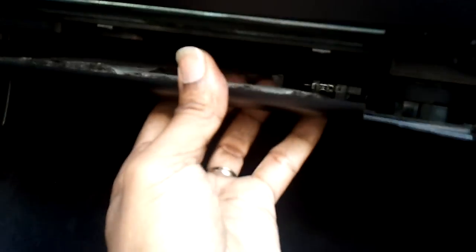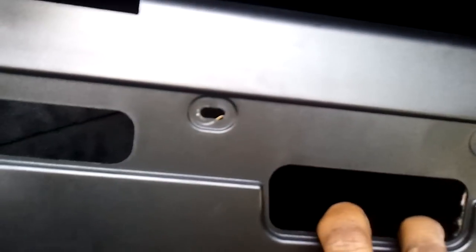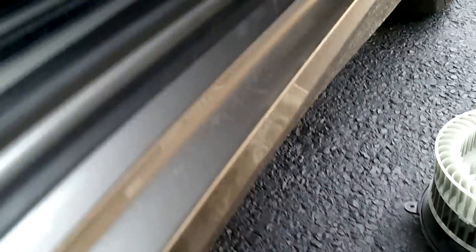To speed this video up, I've already taken out the screws — I'm not going to show you how to take screws out. You have two plugs here: one goes into the speaker, one goes into the light. You want to unplug those and drop this down. These are the places where you want to be removing screws — the corner right there, right here, and there's one right there — so it's five screws you'll be removing. This panel drops right down.